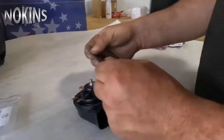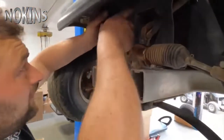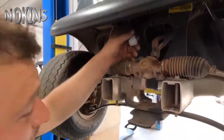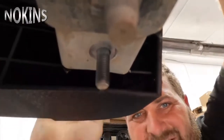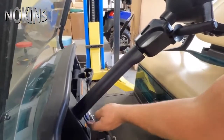Now is a good time to take your horn. Before you install your headlight, find a place to mount and install your horn. We opted to keep things simple — we're just going to run a self-tap right here. Horn is nice and up out of the way with good clearance for wires. Now we'll proceed to install our headlight. I like to run the wire up here, take our headlight, install our connection, and join. Now we've measured, installed our cover, and covered our wire.